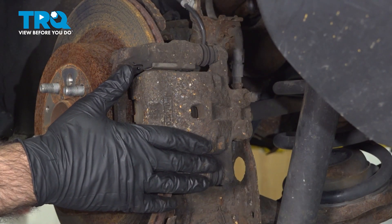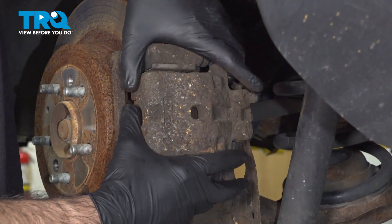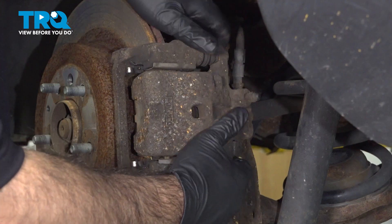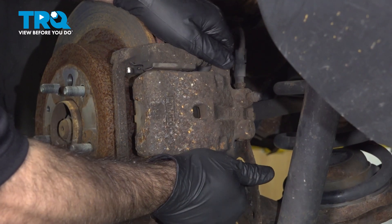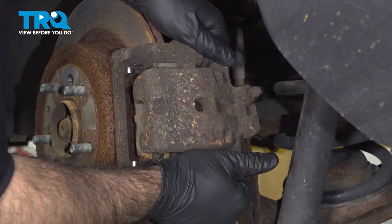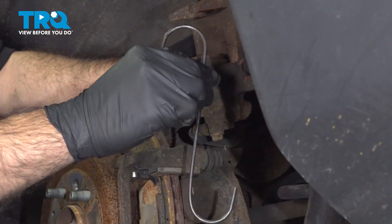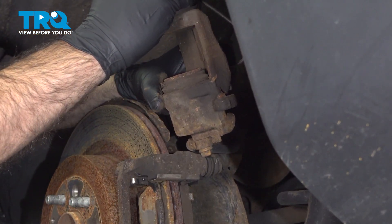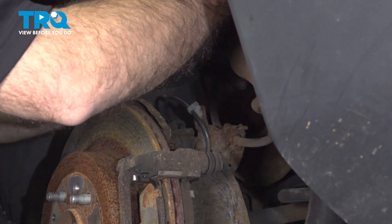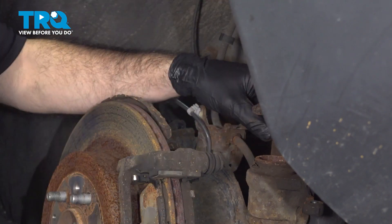Our brake line runs up here. We have a really short piece of flexible hose. You want to be careful when removing your caliper that you're not doing any unwanted damage to that. You can see our caliper is actually pretty well locked onto our brakes. Just try and wiggle it off. If you need to, you can come in from the top or bottom with a flathead screwdriver or pry bar. Remove your caliper. We're going to take a caliper hanger, put it through the back of the caliper and hang it up to the bracket that holds our brake line in the back — not the brake line itself, but the bracket. Keep it out of the way.